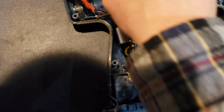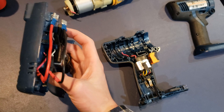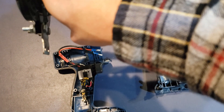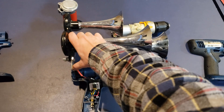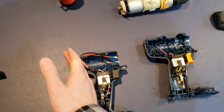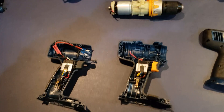The only difference I noticed is this impact has a single thick wall, whereas the drill has kind of a fan attachment to hold the back rotating assembly on the motor — it's a little thicker and harder to get through. So when you take your mounting bolt, you don't have much sticking out and it doesn't sit flat, so it won't mount very well. Whereas on the impact, you have plenty to stick off of and a hard flat surface to mount to. I chose to mount on the back mainly because of the vents on top, and it seems to work very well — the horns don't shake around.